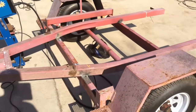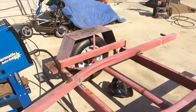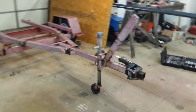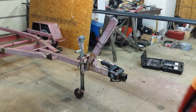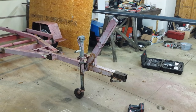Those square tubes are welded onto that channel with 32 inches of weld, so they're not going anywhere. Now we're in the demolition stage — I got through taking all the wiring off. I'm gonna start cutting that thing off. We're thinking about cutting the tongue off right where that rusty spot is, but we don't know if we can based on the way the jack swings and whether it'll hit the truck. So I'm gonna wait to cut the tongue off until we get closer to the end of the project.